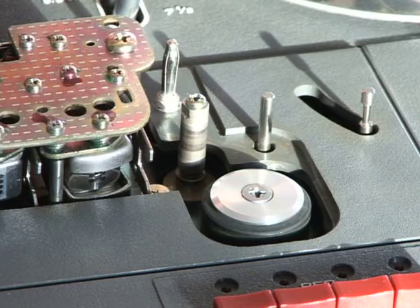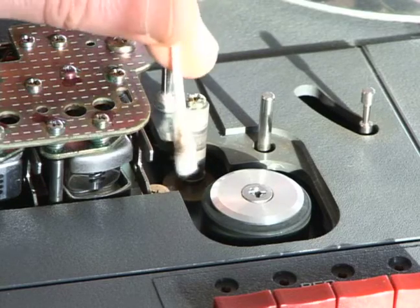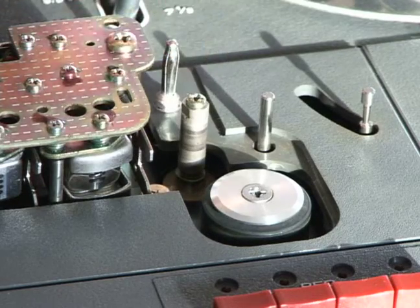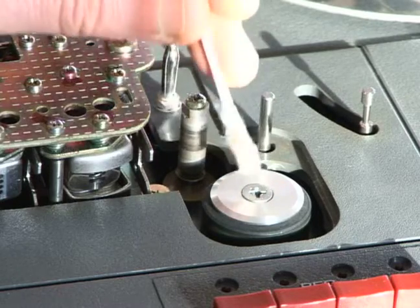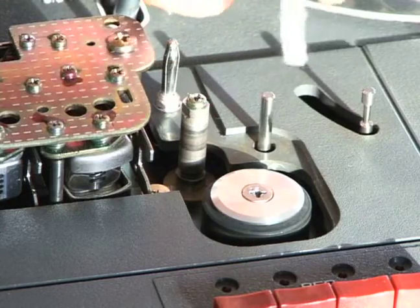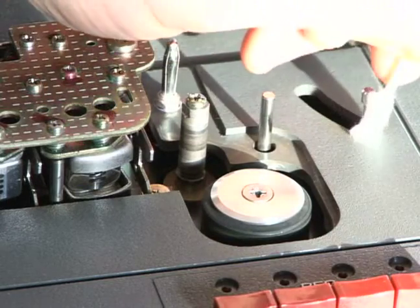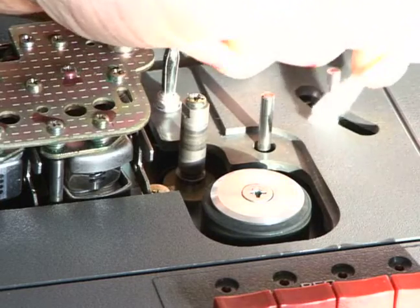How do you get that off? One of the best ways is with an eraser — some use an eraser and then go back and re-clean it. I generally don't do that because it's basically just rubber from this pressure roller here. Same thing on the tape guides — I go through and clean those with the Q-tip.